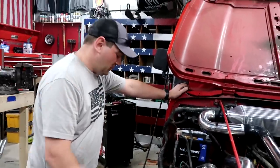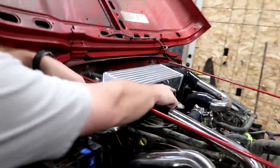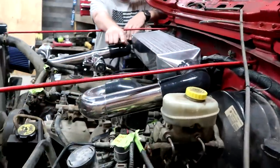I know the current plan is lunch, but after lunch and after you get some more parts — look over here. The silicone elbow, the 90-degree going into the throttle body, is currently sitting at probably 110 to 120 degrees. You're going to find a restriction there.